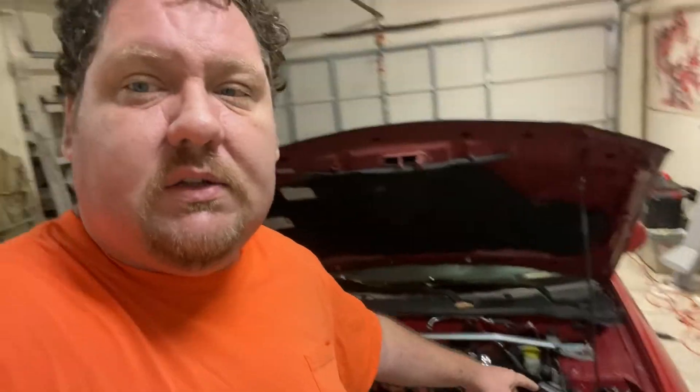He thinks it's an issue with the CAN wires, which is probably correct — if you look at my CAN install video, those connectors behind the dash aren't very good. I also didn't wrap the wires on the CAN wires, though I don't think that's part of the issue, but I'm going to fix that as well. As far as the ECU being bricked, he told me to disconnect the battery, so I did that.